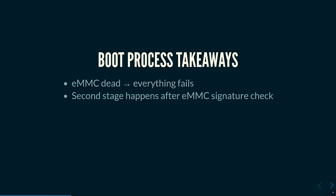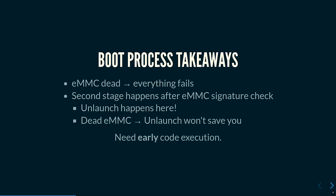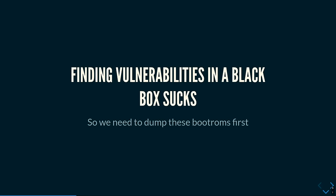The main takeaway is that if your EMMC is dead, your console is a brick. Everything interesting that's been hacked already happens after the signature check. So if your EMMC is dead, any hack already published for the DSi won't help you — you still have a brick. If we want to fix this, we need some way to get code execution super early. Nobody has the boot ROMs yet, and doing black-box vulnerability hunting is not fun. We really needed a way to get the boot ROMs.